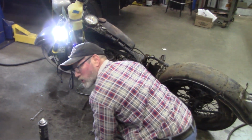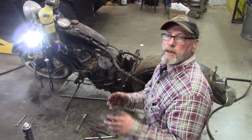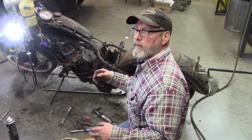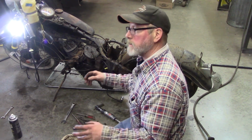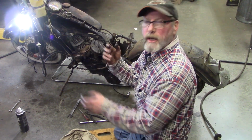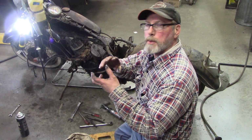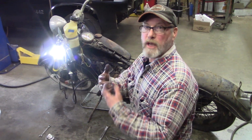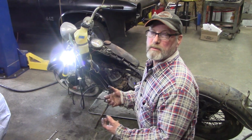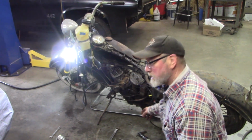This is just direct drive. It's got a sprocket from the motor back to the transmission. So let's say if you don't have enough RPM and the engine's chugging, that's just like a harsh load on the chain and all the connecting rods and everything. So later on they came out with what's called a compensator sprocket. I mean, the Indians had gears. So a lot of guys liked Indians. They seemed like they were more durable with gears in between here, but it's easier to work on with the chain.